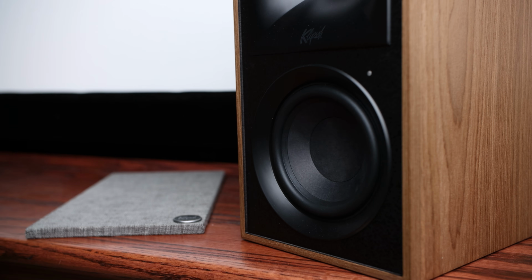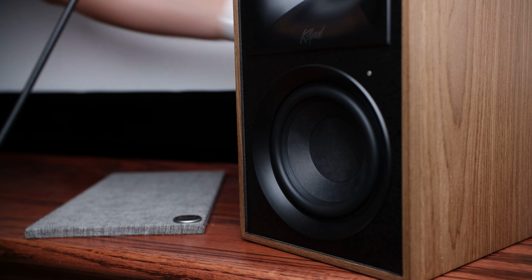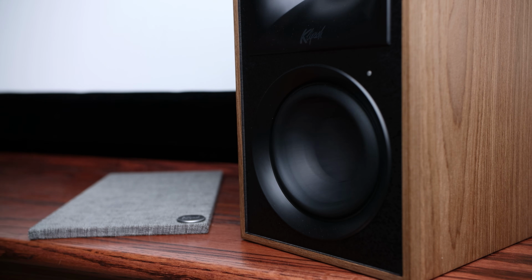One thing I thought was really cool is that as soon as you connect an RCA cable, like a subwoofer cable, to the sub out on the rear of the fives, you can automatically see the crossover engage in the speaker. It goes from massive excursion to very little excursion. What's happening is that as soon as you plug the RCA cable into the fives, the crossover is engaged, and it routes the lower frequencies that would normally be played through the woofer in the fives to the subwoofer instead. By doing this, it really enhanced music big time.